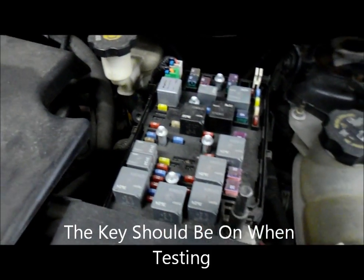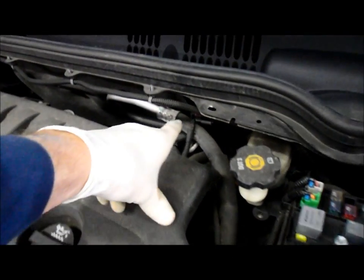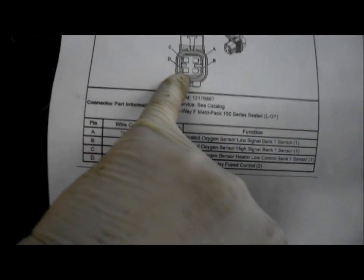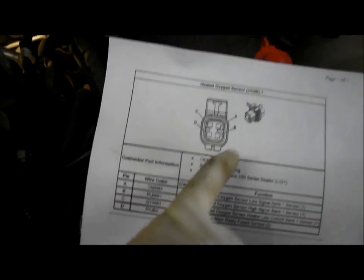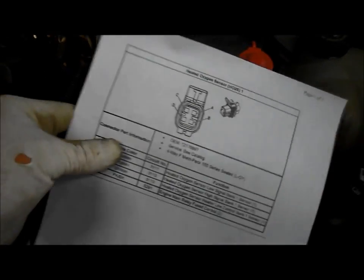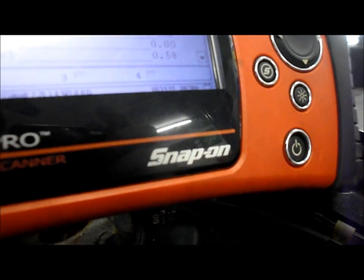So we know that the heater circuit has got power going to it. The sensor itself is located down here. Let me shut the car off — I'm going to pull this cover out of the way and we're going to go down and check the sensor. I did disconnect the connector and I checked to make sure that there was power there — and there was. So that tells me the circuit going down to the oxygen sensor itself is in good condition. I also checked to see if it was a short to ground, which there was not. And the last thing I usually do is just reach down, grab the sensor, and wiggle it around to see if I can get it to do anything.